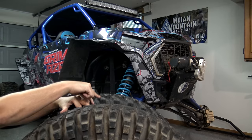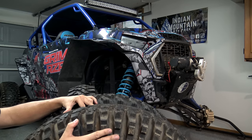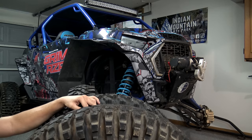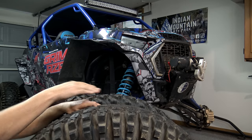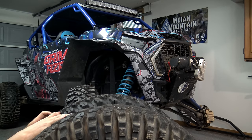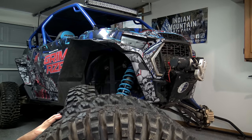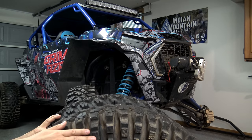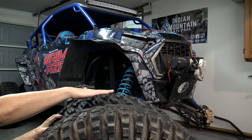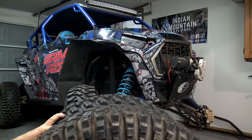Back here we've got a brand new Desert Storm 35/15, and this is an almost new Rockzilla 35/10 on a 14-inch wheel. Looking at them side by side, even though the Rockzilla has a more flat tread, the Desert Storm has a rounded tread right here in the middle. Where the corners of the tread hit, the MRT is still maybe only a quarter of an inch different. So even though the top looks much taller because it's rounded, where the tread actually hits the corner they're almost the same, and they both have 10 PSI in them.